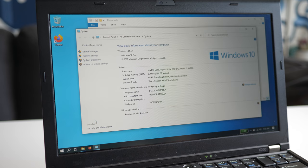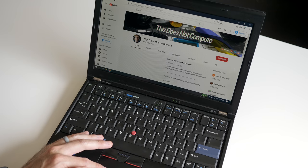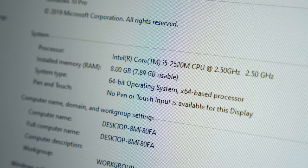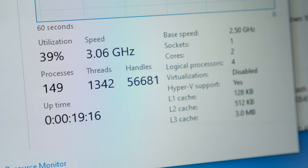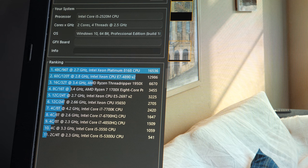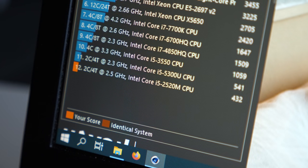And with that SSD, the machine actually performs really well. It boots in just a few seconds, and the UI is nicely responsive. Apps launch quickly, and it doesn't feel like the computer is all that old — it's seriously a good experience. The ThinkPad X220 was launched back in March of 2011. This one has a second-gen Intel Core i5, specifically an i5-2520M. That CPU has two cores and four threads, with a base clock of 2.5 GHz, and uses 32 nanometer lithography. In an era where laptops commonly have 6 and even 8 core CPUs based on 14 or even 10 nanometer processes, this i5 looks positively ancient, and the Cinebench results certainly make it look that way, scoring a 432.